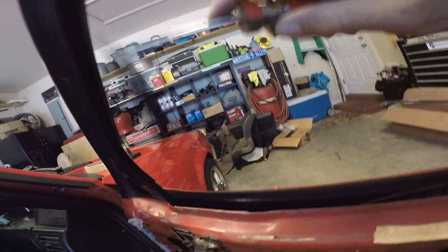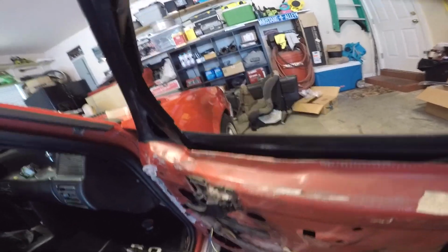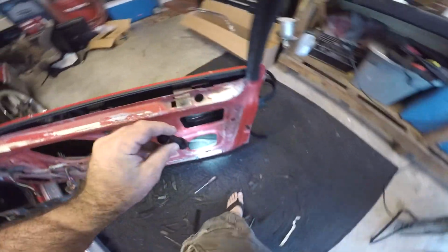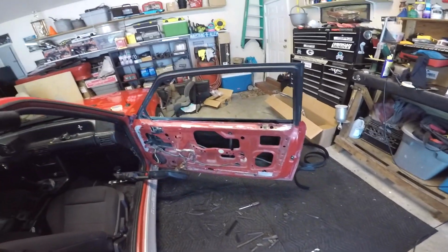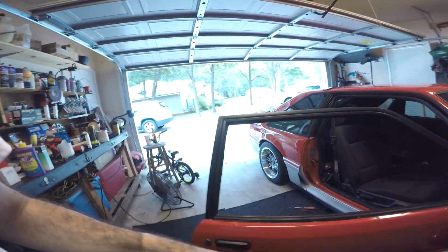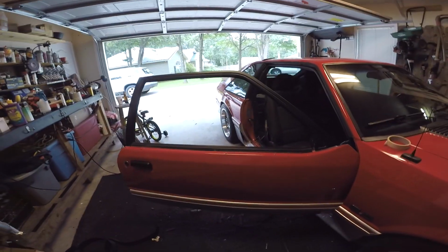So I went ahead and painted the door frame. That's the best time to do that while everything's out. That's not good. This is ridiculous. So if you've never done this before, expect a lot of debris down in the bottom here. Especially if they start chipping and breaking apart, you're gonna have to go in and dig all that out, or get a shop vac or something and get that done. Anyway, the door frames are painted, cleaned those up, painted everything, so we're good to go now. Only thing left to do is put the run channel molding in.